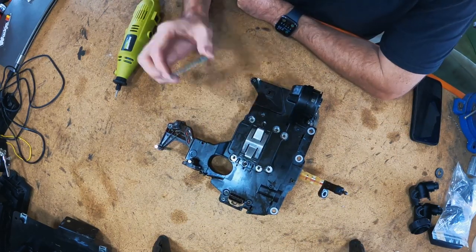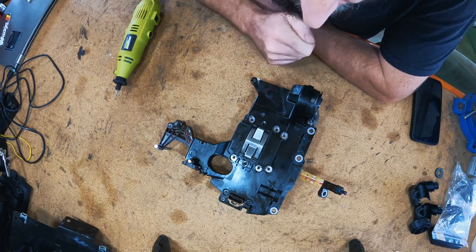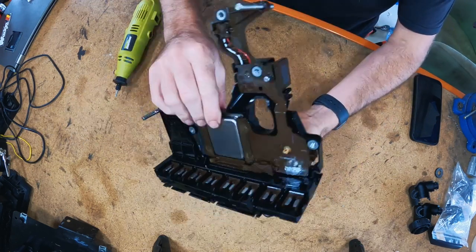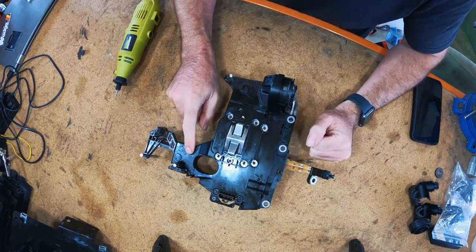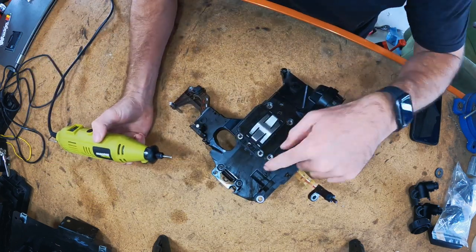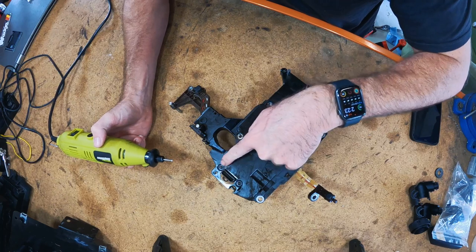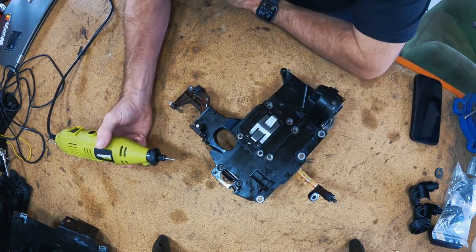So the way to do it, and I'll put a link to the Ryutech video as well. The Ryutech also, you don't need to disassemble so much of this. But basically what I'm going to try and do now is get this black section off. I've got my trusty little Dremel, so I'm going to basically Dremel away these little plastic welded rivets. There's two brown ones there, and then these two black ones there, and then we'll see if we can get that cover off.